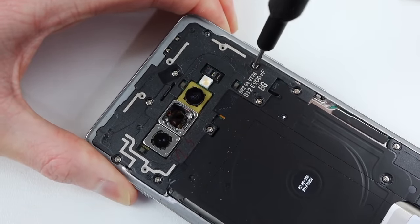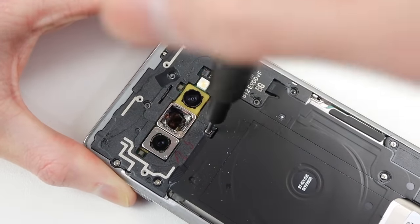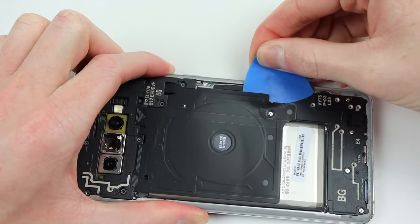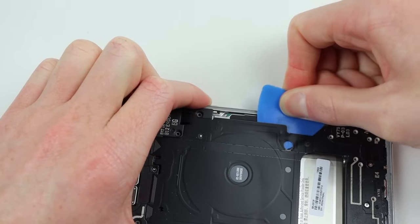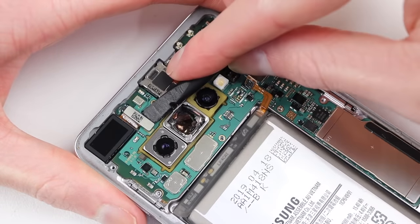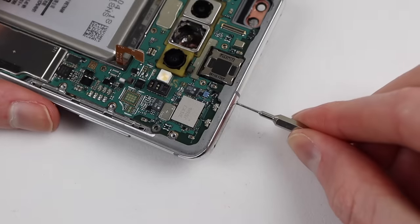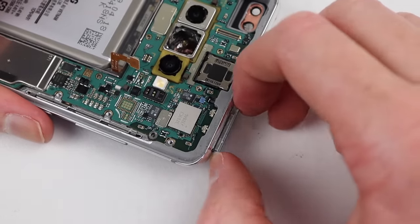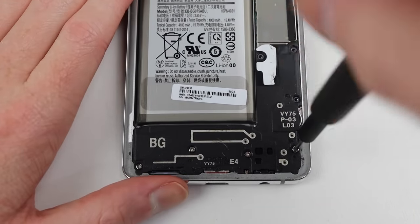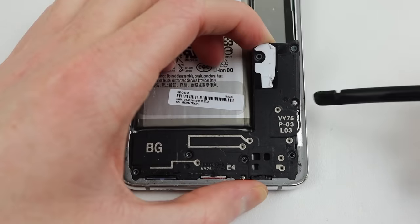It's time to dive a little bit deeper inside this phone. We'll need to remove the wireless charging coil, and to do that there are several Phillips head screws and some light adhesive at the lower portion of the wireless charging module. With that out of the way, we can first disconnect the battery before working on any internals. From there, I'll remove the front-facing cameras, one Phillips head screw, and the SIM card tray. Down at the lower portion of the phone, there are more Phillips head screws which will need to be removed so I can unclip the speaker and get access to the lower portion of the motherboard.